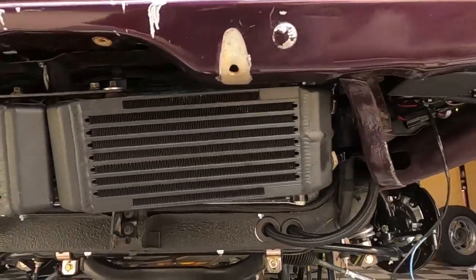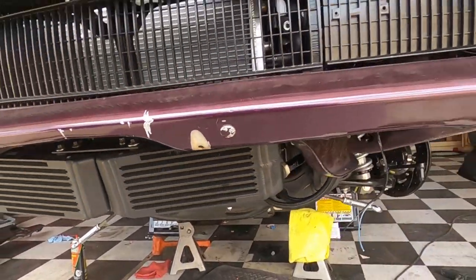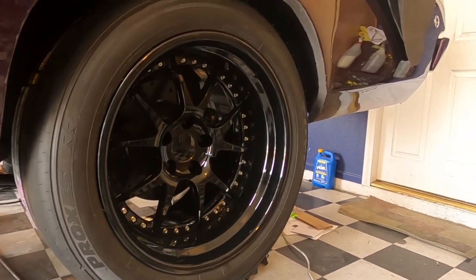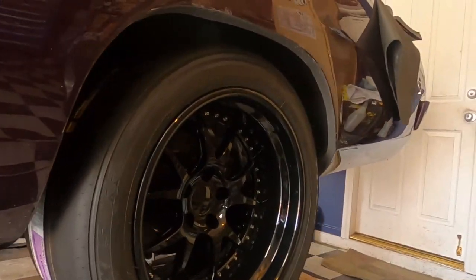It's starting to look like a car, boys — we might even be close to getting that first start here real soon. I've got a few other things to do, like the headers, but I have to drop the transmission and I'd really like to get it on the lift. I can't move it right now because I don't have the front set of wheels yet. But remember I was talking about the rear wheels? We got it figured out — the barrels were flipped on the rear, so now they actually fit within the inner tub like they should. It's still a massive 13-inch wheel but now it fits properly. We just need to get the fronts figured out. Let me know what you guys think — if you have any ideas for the oil cooling lines or relocating, hopefully this helps. Hit the subscribe button, hit the like button, hit the bell for notifications, and stay wrenching.